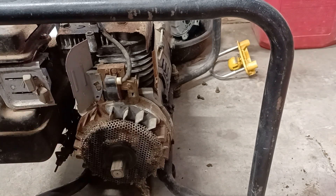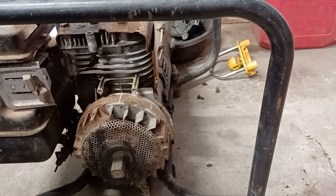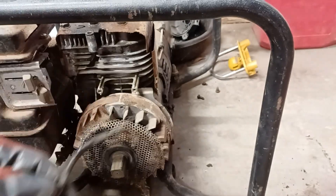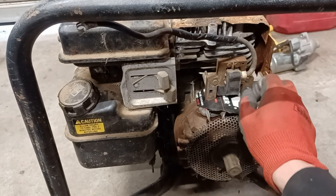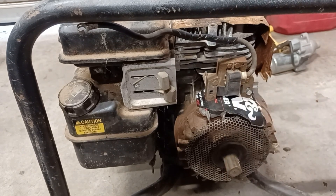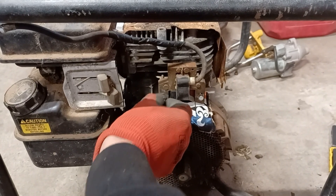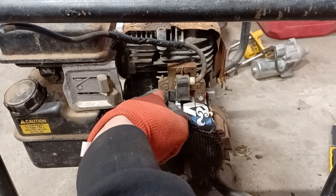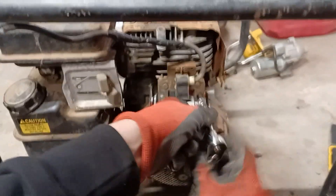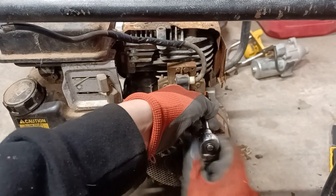I am going to show you in this video how to set a coil up for the right timing. What you want to do is get a piece of cardboard — most likely a business card — put it down on top of the magnet on the flywheel, then stick your coil in and tighten it up. That's going to be the perfect gap to get your coil perfectly timed, and it works pretty much every single time. You can see the little electrical tape over the coil wire — some people might get mad about that, but it's just a small repair and it doesn't really matter that much.